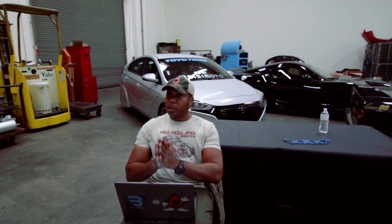Okay. So he wants to know the differences among types of fuel. Well, that question could be quite wild because different fuels have different caloric content. We talked a little bit about that last session. The fuel is a very important component of making power. As we talk about, once again, the internal combustion engine being an energy converter, you have the initial components of that conversion, which is a chemical energy. You have the oxygen in the air, which combusts to form carbon dioxide and water and create a lot of heat, which does work on the pistons. You have the fuel, which has a very strong influence on how much power is being made.